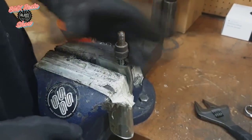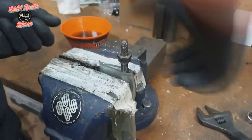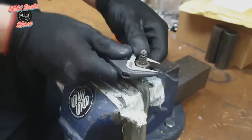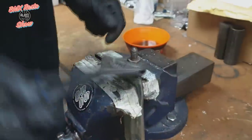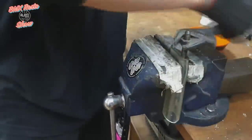You can see a bit of rust on the end there and a lot of caked on dirt. So just clamp it in the vise using a bit of plastic protection not to damage the axle and get all these off. We're using the same rust solution that we used in the first episode — check out that episode to see which one we're using. Once we get all the parts off we just dump it all straight into that solution and let it soak.